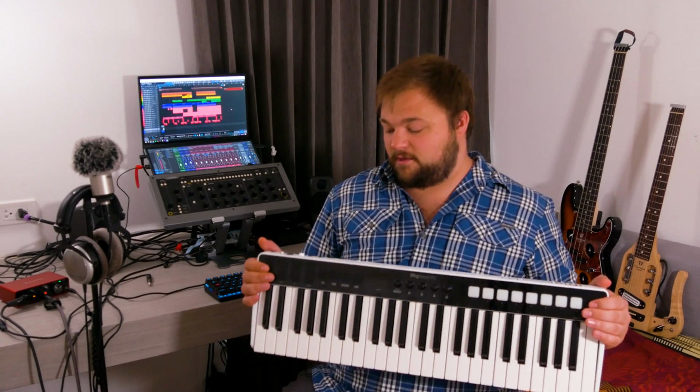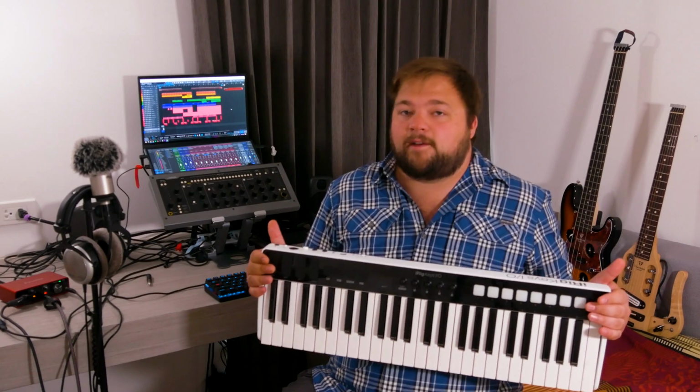You know, maybe if there's somebody out there who was recording a podcast or something like that, and all they needed to do was just get their voice into a computer, maybe. But in terms of using it for any kind of professional work, the interface just chokes. I mean, again, it doesn't even have any dedicated drivers running it. They expect you to just use Windows Audio, which is horrible. Those are barely even drivers. They're really just meant for you to be able to hear Netflix when you watch it. They're not meant for professional applications at all or using with professional equipment.